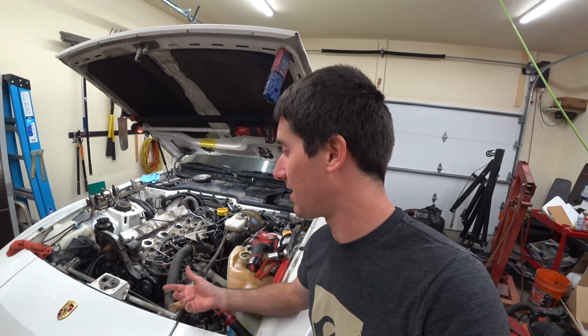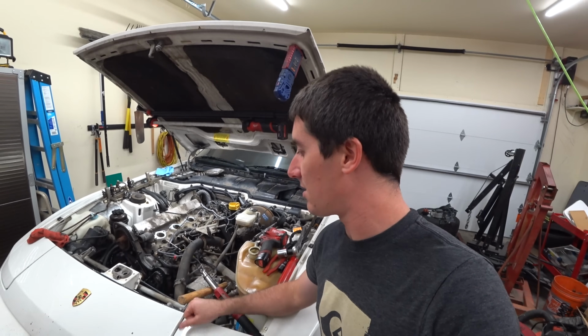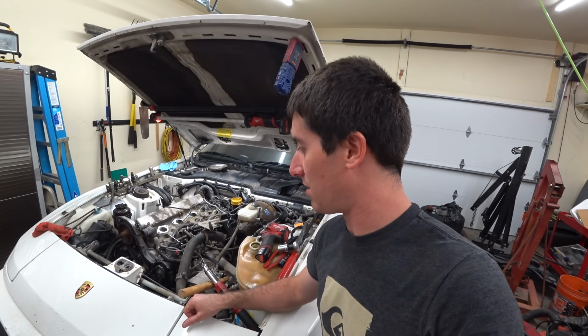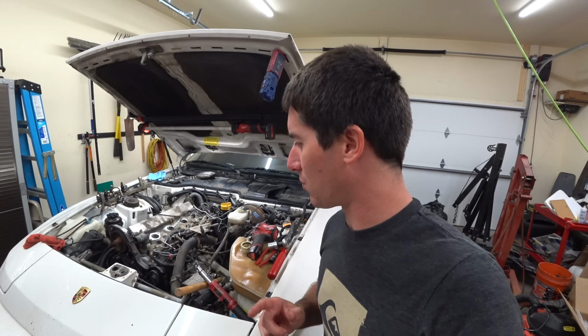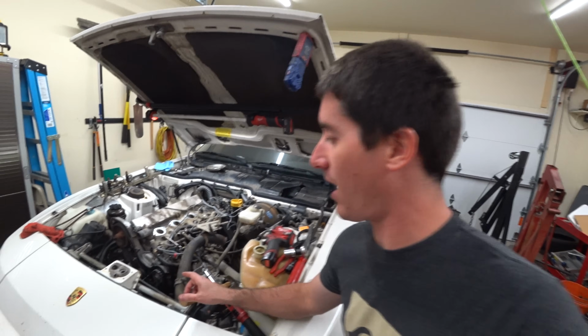So with that said, what we got done today was the oil cooler, and that's completely finished and all tightened up, and all of the timing belt and balance belts. Also, I think the balance belts weren't aligned. Somebody had done all of this in the past, and I think they had done a really bad job. None of the marks lined up on the balance shafts.